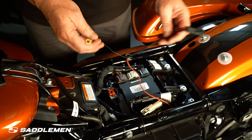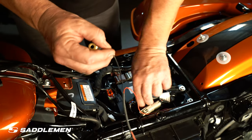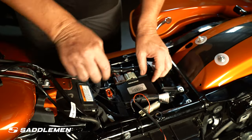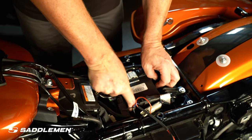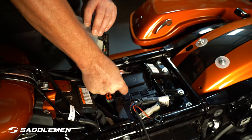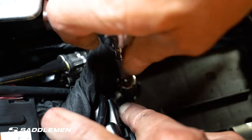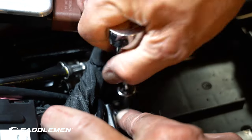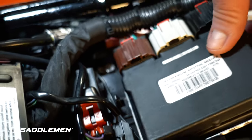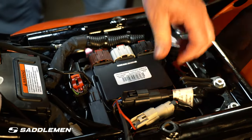Now that the wire's been run up to the top, you're going to have your plug power to the seat and your ground. You can take off this clip and run the ground under, and you also have two clips here to remove the ECM. There's the battery terminal on the negative side. Use a 10 millimeter and tighten that terminal down to the battery terminal, and run that cable behind the clips for your ECM. Snap that ECM back in place and you're good to go.